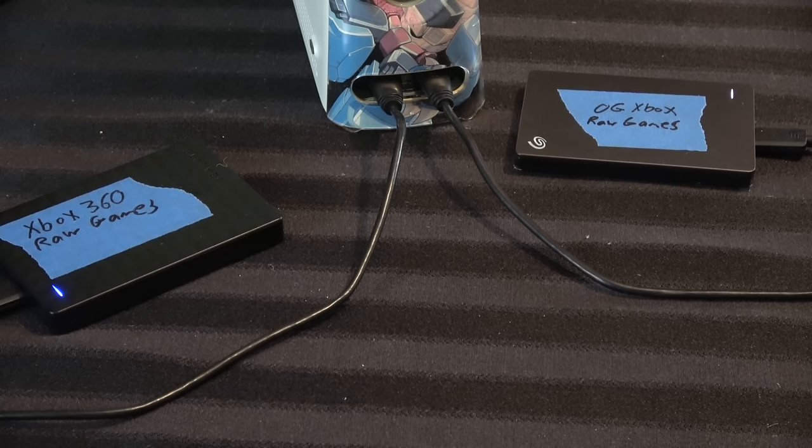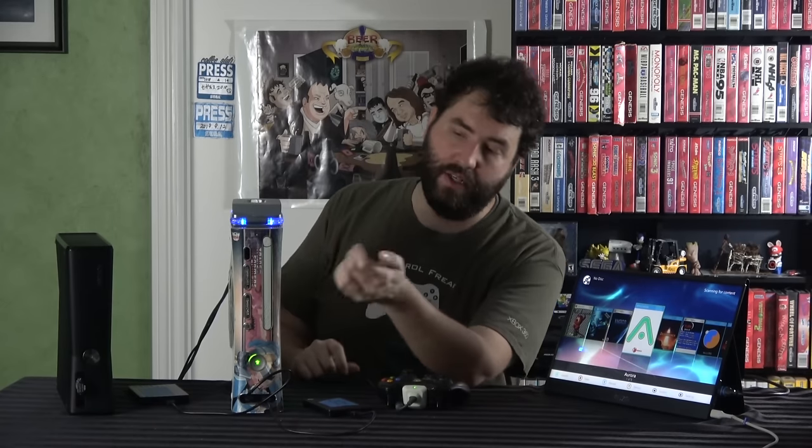So I've got every original Xbox game I own on this hard drive, organized based on what was originally Microsoft-certified compatible and what is not. And this hard drive has Xbox 360 games I ripped myself. Now, talking about the hard drives — the Xbox 360 is only capable of storing two terabytes of storage per input, meaning each hard drive can only be two terabytes. If you put anything bigger, it'll either not recognize it or only recognize up to two terabytes. It's just a limitation of the software — two terabytes is always a very specific limitation, kind of like how FAT32 can only have four-gigabyte files.